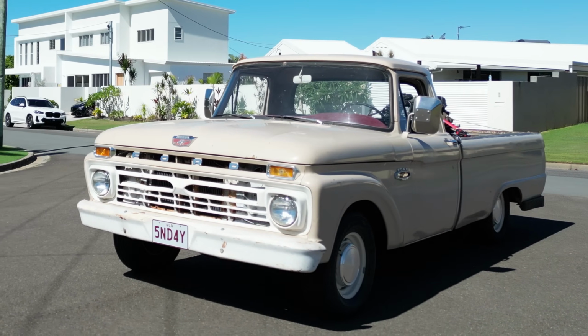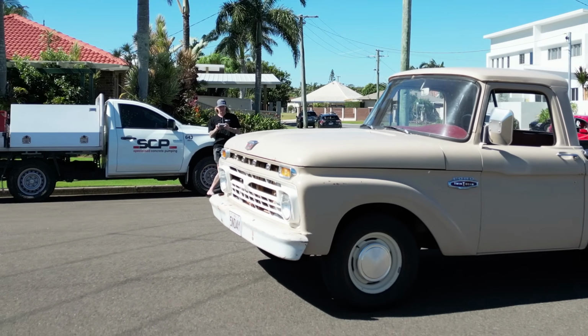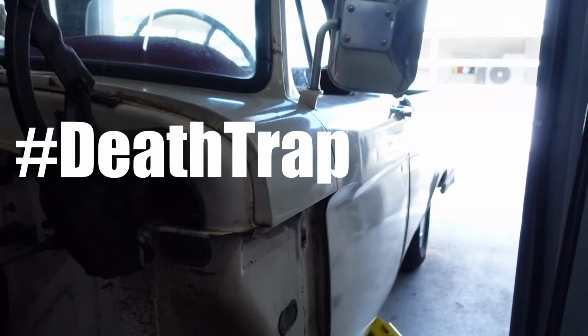The booster is what assists your foot, powers your foot. In an old car like Jacko's, this one here, we're putting the barrow in. That one doesn't have a brake booster at all. It only has a cylinder, and your power brakes for that is two feet on the brake. It's basically an old 1966 brake master cylinder.